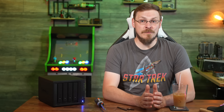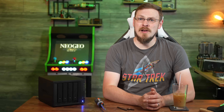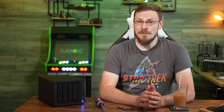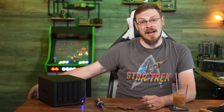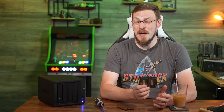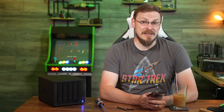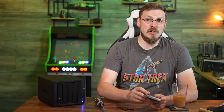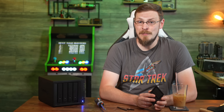I'm starting to feel like any server — whether for basic file storage or network services — if the intent is to run multiple services, they need to be coming with a minimum of 8GB today, whether that be a Raspberry Pi, a Zima board, or an entry-level NAS box like this. Modern CPUs take a major performance hit when stuck with only a single channel of memory. While I appreciate Synology using 3200-speed sticks, it's all for naught if they only include one. I'd much rather see 8GB of 2133 than 4GB of 3200. If you wind up with a DS923+ and need a memory upgrade, just about any DDR4 SODIMM stick — whether ECC unregistered or non-ECC — will work fine. At $60, you can get a 16GB kit of ECC-2666 from TimeTech, or a Team Group 32GB kit of 3200 DDR4 for as little as $50.